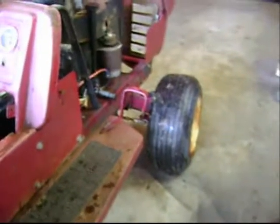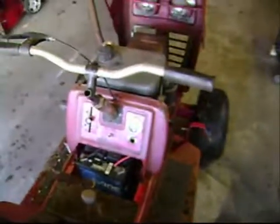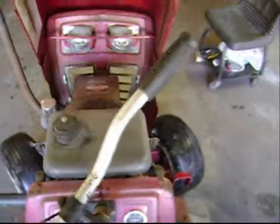So it goes, I hope you can see that. You've got a rod that goes from one wheel, the other wheel, up here to the middle, and then that gets connected to the steering arm, flies back right over to here, and then right above that is that universal joint. So there's really not a whole lot of play, and it's a quarter turn, left-right is full lock, and it's really not that bad